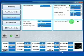This is a security functionality that activates when we have too large gas injection times, so for security reasons we switch on petrol. You will see here the LED turns on when you are at very high RPM, for example 5000 or 6000, and you are requesting very high power from the engine.